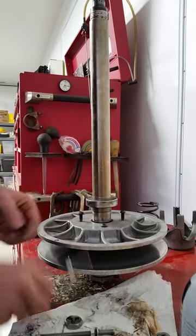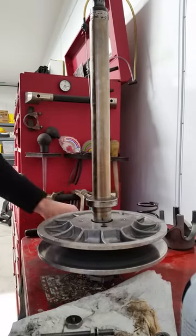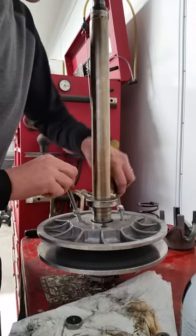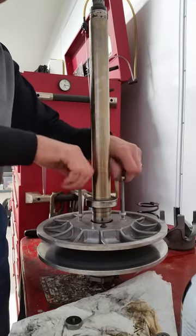Put a little bit of lube on the washer, then remove two of the retaining bolts on the back side of your secondary clutch — two bolts in — and snug them down into the bottom of the helix.